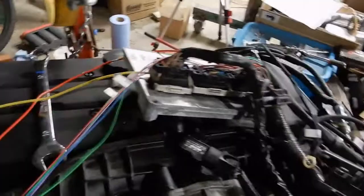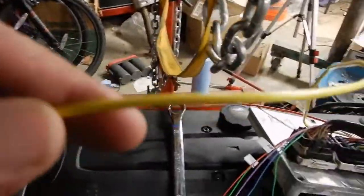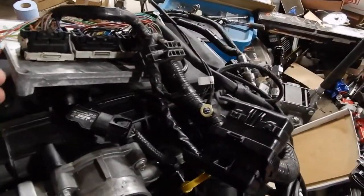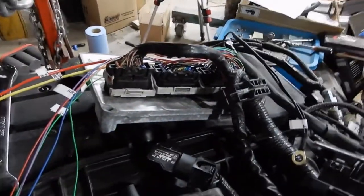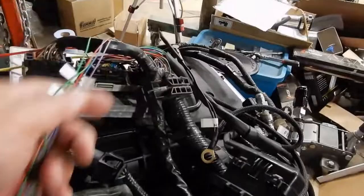There are the inputs to this thing — as I've discussed in previous videos, they're labeled. This red wire is the ignition wire, and this is my start wire. When you turn the key to on, the ignition wire goes live; when you turn the key to start, the start wire goes live. I'm probably going to tap the fuse box input wire for the ignition wire, going through the fuse box I set up in the old airbag compartment — for things like gauges and so on.